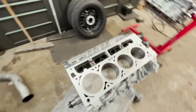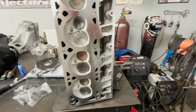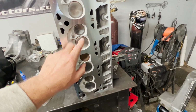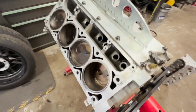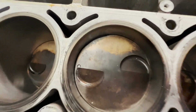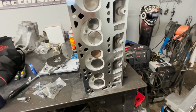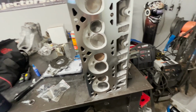So we got our head studs here. We'll get these out and start putting them in the engine. We can start getting the heads put on, torquing that down. We got the lifters and stuff in. And as you can see, I got them cleaned up. I had to pull this valve and these valves out to clean them because this one had aluminum embedded in it. You can still see some here from where this piston on that motor got all marred up and it chewed up some of the piston. But yeah, right there, you can see where we got a little bit of that piston, nipped it there, and then obviously where the head gasket was blown. You see the head was clean-ish. I went through and cleaned them, put them back together, and then vacuum checked them, and they all pulled really good vacuum, so the valves were sealing up.